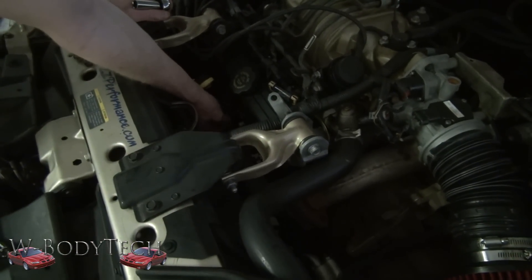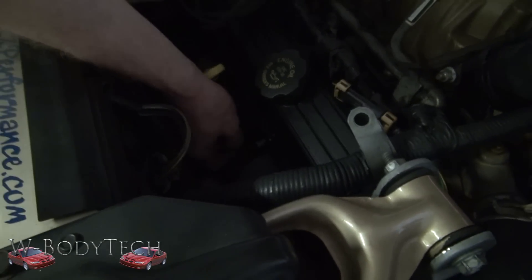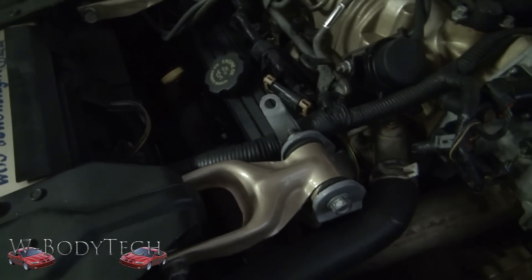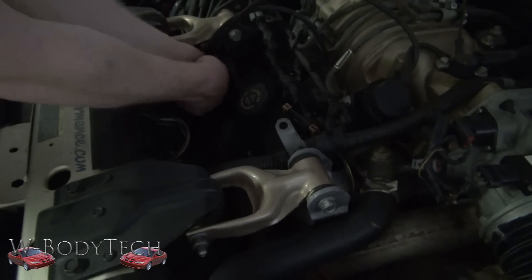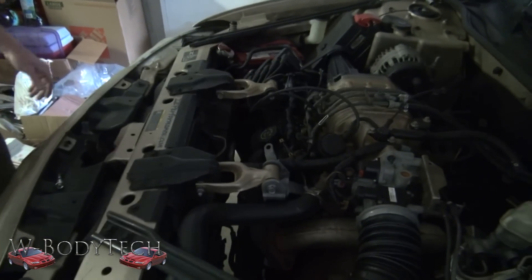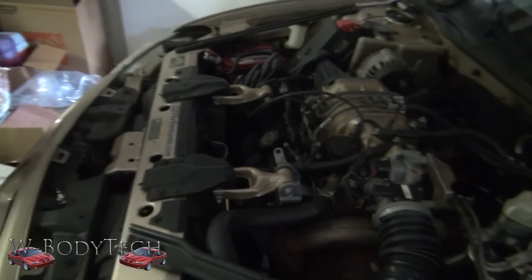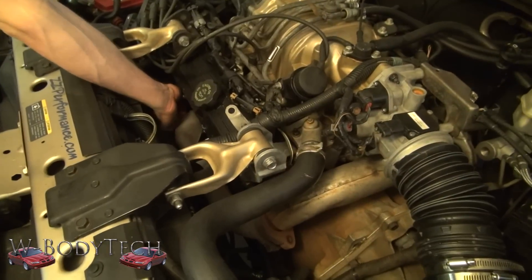So you're removing the oil dipstick — removing the top nut that's on the manifold stud so I can pull the dipstick out to avoid damaging it when I pull the manifold out. Yeah, try doing that to a 3.1; that doesn't come out. So if your stud's in good shape, you're not going to buy any studs.